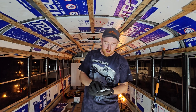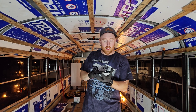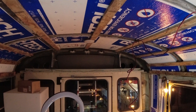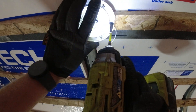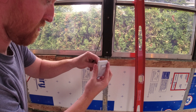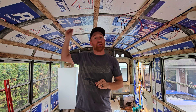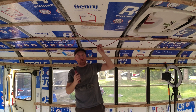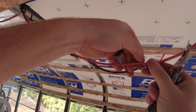I'm going to run a ground wire for everything I'm working on. I'm going to temporarily install each of these lights — they pull off pretty easily with a couple of screws. Ideally I'll have four lights in the cabin, one in the kitchen, one in the bathroom, and one in the bedroom. With all the lights temporarily in place, it's time to start hooking up all the wiring to the main harness. I'll be wiring them up with switches purchased online that work with a 12 volt system. I'm going to split the wires apart and strip them in two sections so they can't rub against each other later on.